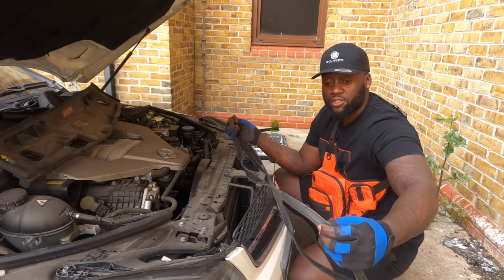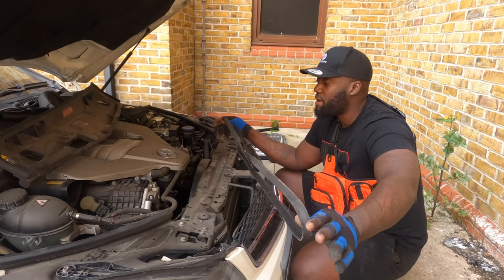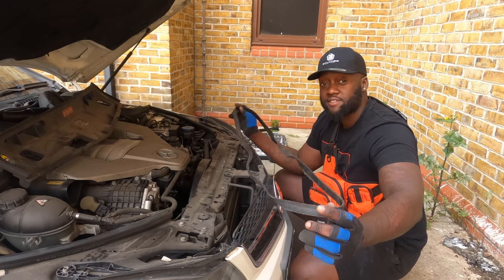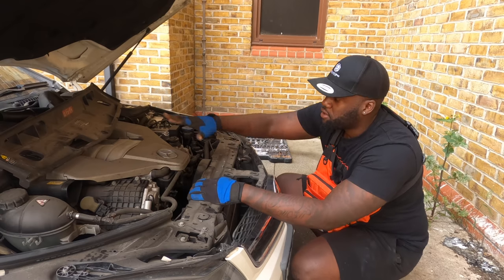With a little bit of elbow grease, we've got the old auxiliary belt off. It's not broken, but it's really badly damaged. The good thing is when the new one comes I can check it's the same size and confirm it's correct. Now that I've taken off the top cowl, I believe I've got enough access to remove the broken pulley and replace it right here at the top.